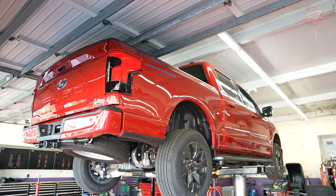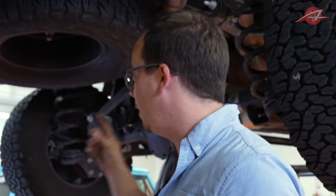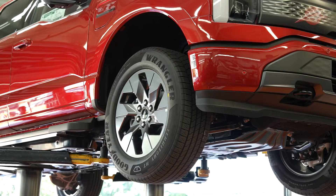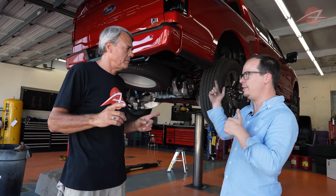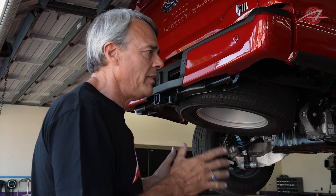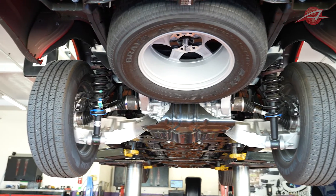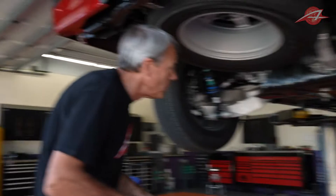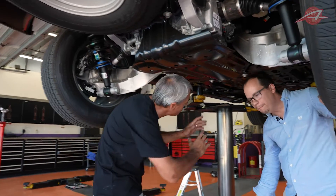We're about to look at the Ford F-150 Lightning, which is an electric truck. When you electrify a vehicle with a solid axle it has huge implications on the suspension — which might seem strange at first: why does being electric mean you have to change the suspension? Well, let's have a look. It's pretty wild how much Ford changed the frame from the regular F-150 to the Raptor, and then this is on the same platform roughly. Get ready, because the changes to the frame here are a hundred times more than from the base to the Raptor. In fact, the back third of this frame is completely new — totally different from the base or the Raptor.